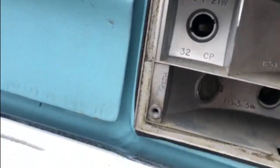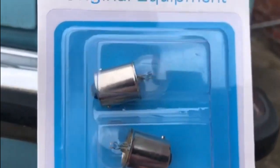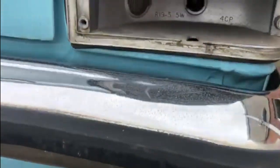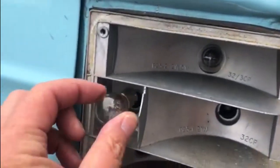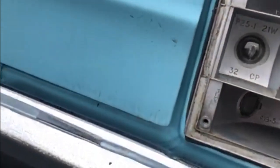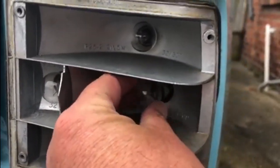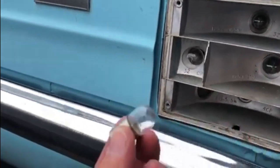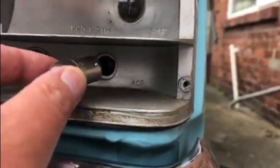So, I've nipped out and I've bought a couple of packets of these just to use them. They're the 5 watt ones. The bulb side of it, the glass part, is a little bit smaller, but the bayonet is exactly the same. So, hopefully, they're the ones that should be, and it should just be a case of pushing them all and clipping them all straight in. So, let's start with a bulb in the reversing light. Put that one in. I'm going to try what will be the indicator and get that one in there. If we take one of the ones out of the packet — one of these little ones, you can see how small they are. These are just 5 watts. Let's see if I can get that in there as well.